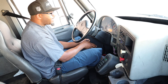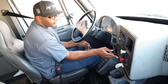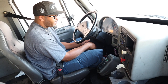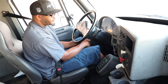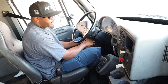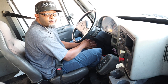My low air pressure warning buzzer light did come on at 60 PSI. Now it's the tractor-trailer pop-out valve test — 40 PSI for my trailer, 20 PSI for my tractor, never tractor before trailer. I'm going to continue fanning down and that's when my pop-out valves should pop out. Both of my valves popped out at 30 PSI. That concludes my pre-trip.